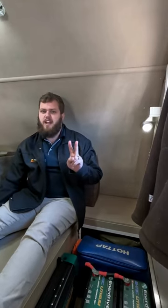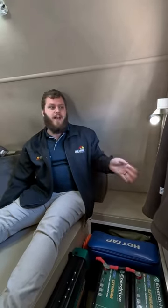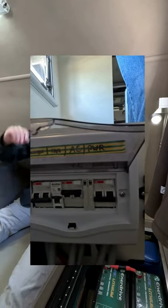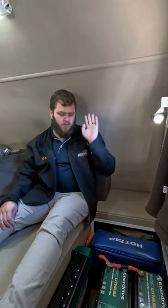The second most common thing to check is the same style switch — a 240 volt safety switch — but it's your factory one that came in the caravan as standard. Quite often it's near the 240 volt inlet like a 15 amp inlet, or it's inside a cupboard above your microwave or beside the cupboard somewhere. You need to make sure that is on as well.